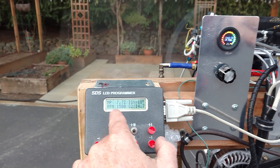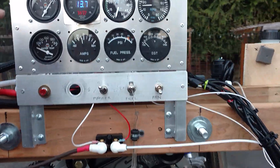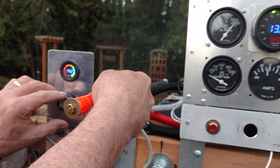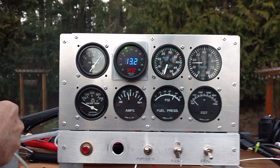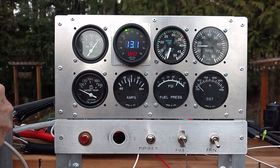And last, you'll see manifold pressure, O2, and ignition. Come over here for a second. You'll see over here this is the air fuel ratio, and watch right here when I adjust right here. You can enrich this if you want, or make it leaner with just a slight turn of a knob.